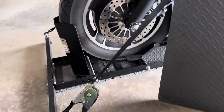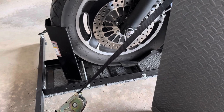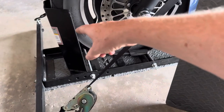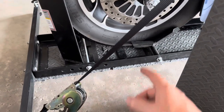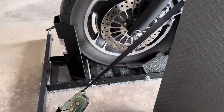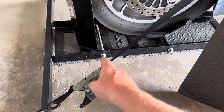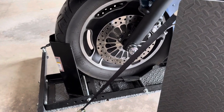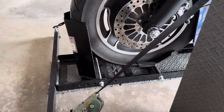The second tip is guys have trouble getting the bike out of the chock. The main thing you have to do is adjust the front piece forward or backward so that your tire doesn't drop too far into the chock. I suggest starting out in the third or fourth slot if you have a 16-inch wheel. If you have an 18-inch, 19, or 21-inch wheel, then you'll want to move it further towards the front.